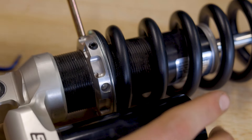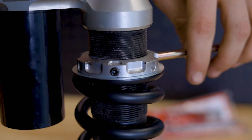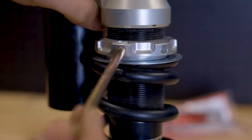Hopefully you didn't throw it out. Before backing off the collar, please make sure the threads are perfectly clean — no muck or grime — so you don't destroy the threads on your shock body. Now that you've undone your grub screws, you can use that rod to turn the collar and release the preload off the spring.